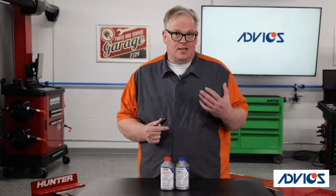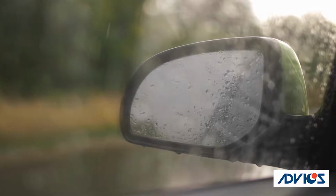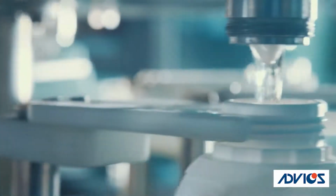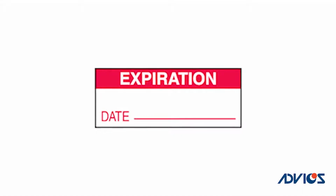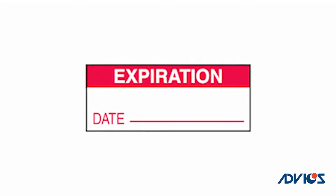Brake fluid is not selective about the type of water it absorbs. It will absorb water from vaporized water, aka moisture, and even the outside air. When a bottle of brake fluid leaves the factory, it is sealed, so it doesn't come in contact with outside air. Most fluid manufacturers will fill the small space at the top of the bottle with nitrogen. Some say that a sealed bottle has no set expiration date, so if it is sealed on a shelf, it should be good for many years.